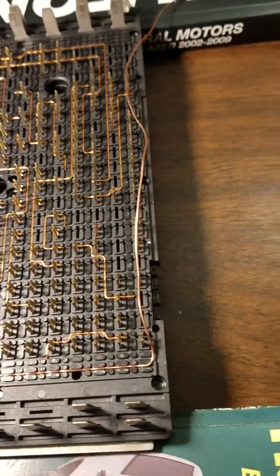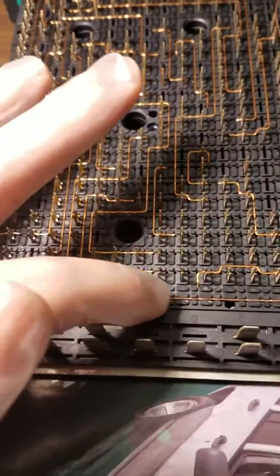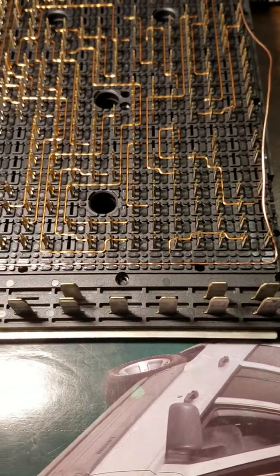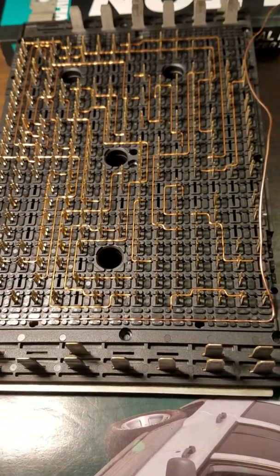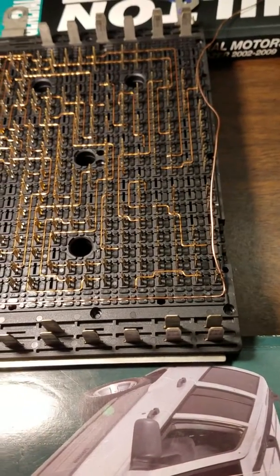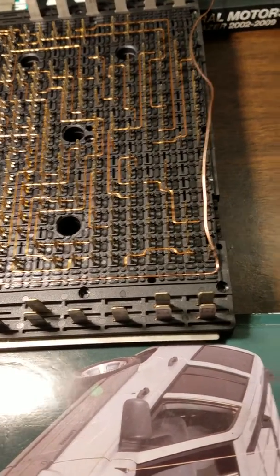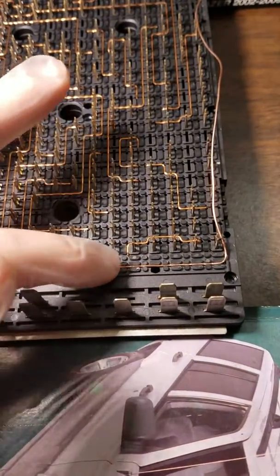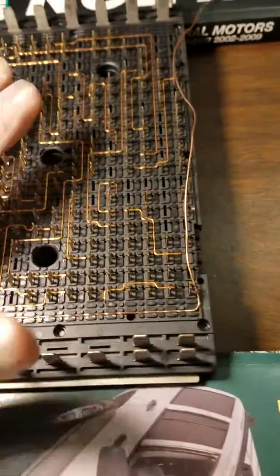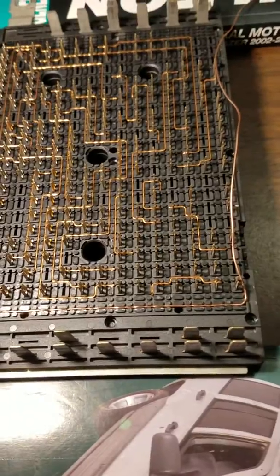So what I'm in the process of doing now is I found the broken wire and I bought some 20-gauge copper wire from Lowe's, and I'm trying to get it right back in there and put it back together. This will be video one — I'll probably come up with a video two showing it going back together in the hood compartment. If you guys are having trouble with a P1682 and the ignition turns over but does not crank, based on a lot of these forums, there's going to be a cracked wire in every single one of them. You used to be able to get a whole new fuse block from General Motors, but they've discontinued it, so you have no choice but to break this open and do it. See you guys later.